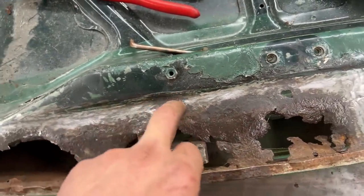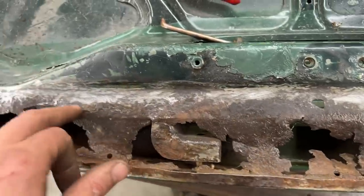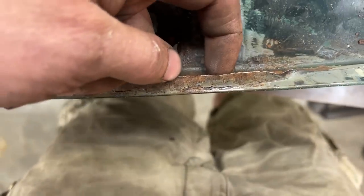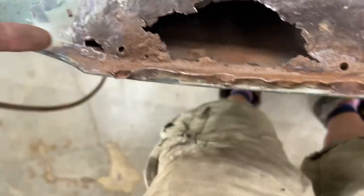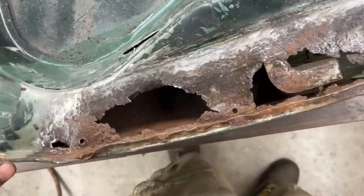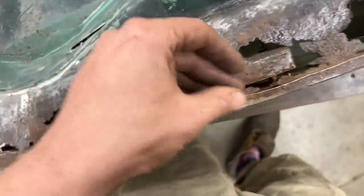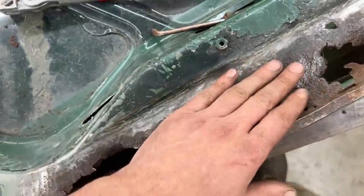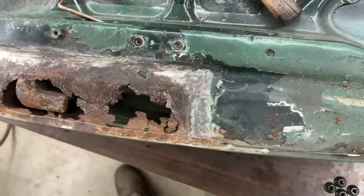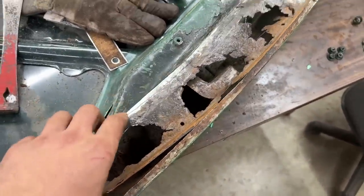Here, like I said to Nicola, I don't want to go into this bend so we're gonna stop somewhere here. This way we're gonna have to make just one bend, this one here. We're gonna have to cut it here, and here, and here to finish it. Unfortunately we're gonna have to cut through the flange as well. Then we're gonna be able to remove this rusty piece from here, and that's gonna make it easier to unbend this flange and straighten it and de-rust everything. Then Nicola is gonna try to make this patchwork, first out of cardboard.